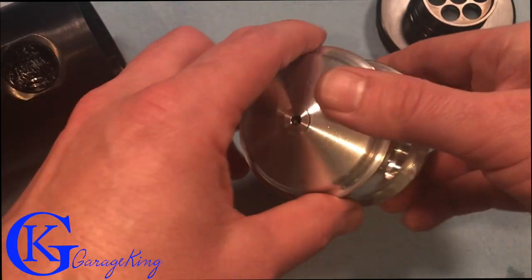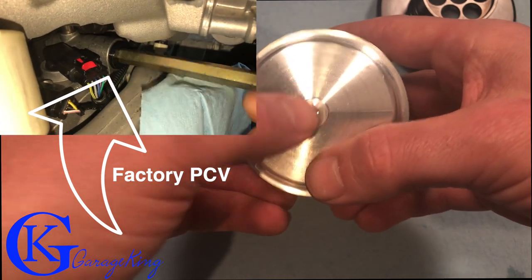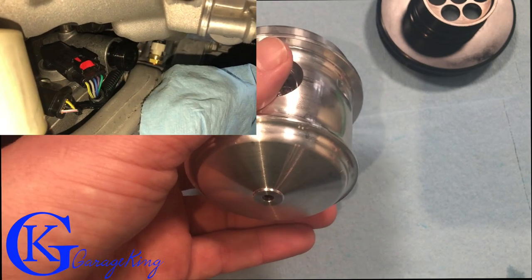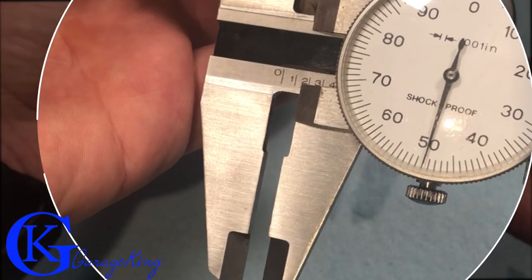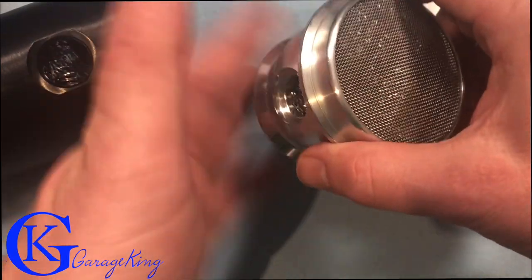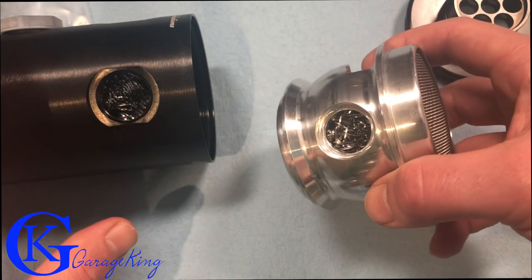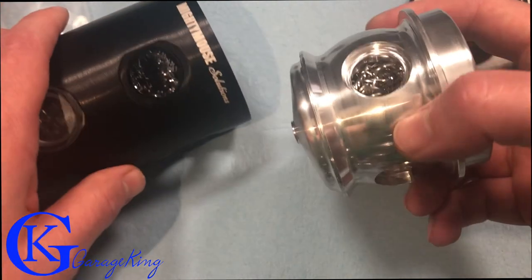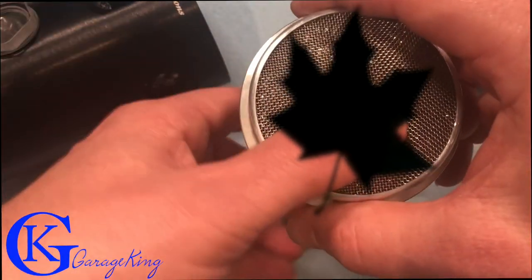So let's talk about this orifice. How does GM regulate the flow? They have a one-eighth inch orifice — it's fixed, it's underneath your blower. If you take out that plastic piece underneath your blower, it is one-eighth of an inch. So I'm assuming this is going to be very close to one-eighth of an inch, maybe a tad bigger to allow for a little pressure drop since we're carrying everything further. Measuring it, we're at 0.15 inches — so slightly larger, which is fine. That's how they regulate it. So when it says self-regulating, it's just a hole drilled in it similar to the size GM uses. Make sure if you install this, get the Mighty Mouse diverter because it's full flow. If you put another company's restrictor in there, it may have a restriction and then you'll have two restrictions in your system — and that is not good; your engine's not going to operate properly.